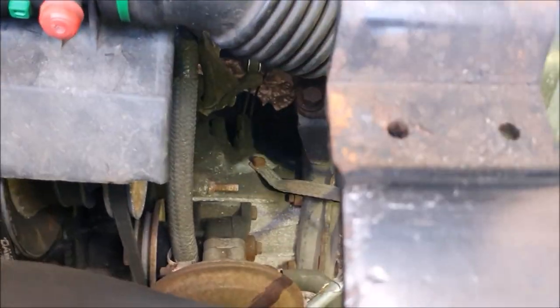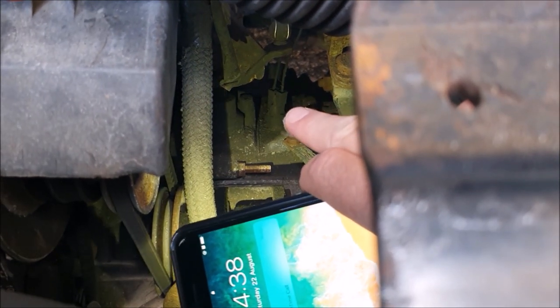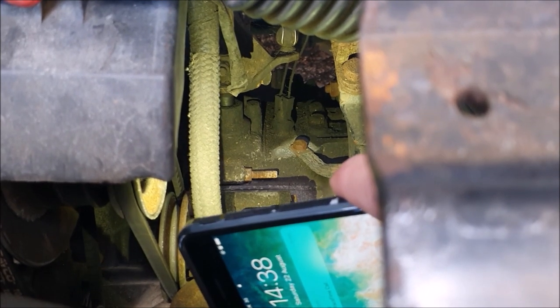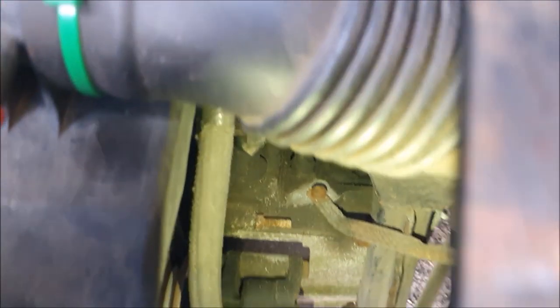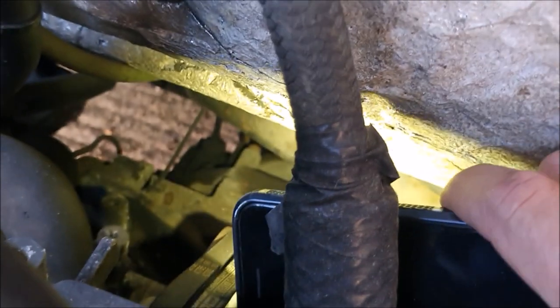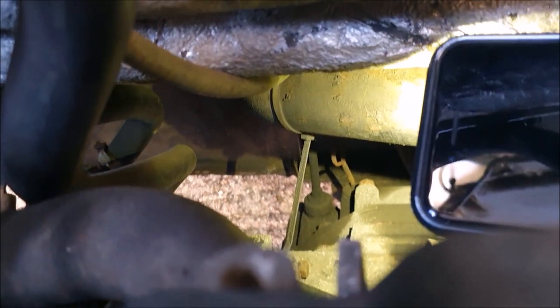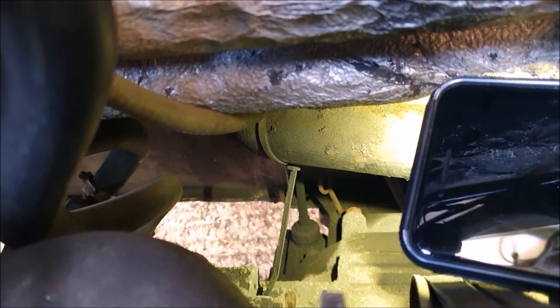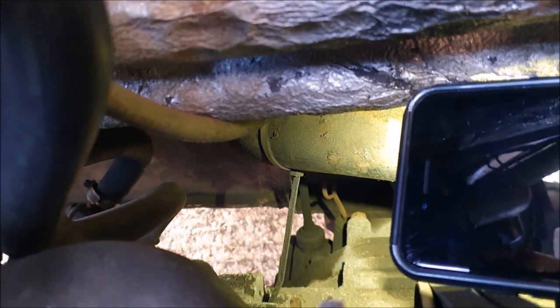Right, we're going in. Under here, I think I'm shining light on the component with the two wires coming out — that is the reverse light switch sensor, and that's where it's recommended to fill the gearbox up with oil. Moving back, somewhere down there — right down there, look — you can see with the little loop on the top of it the dipstick for the gearbox. I'm going to try and get myself down there to dip the gearbox.